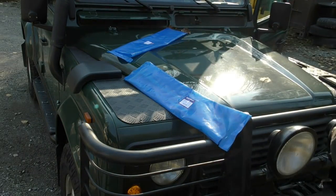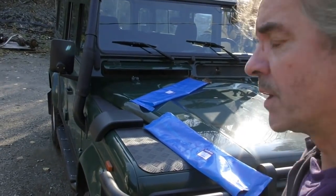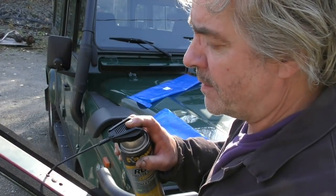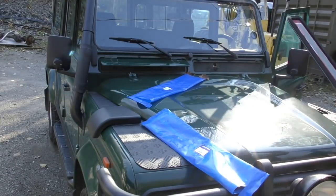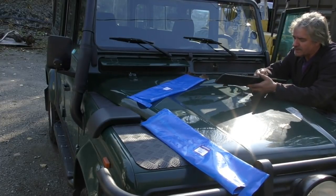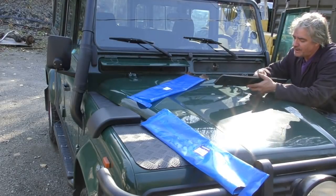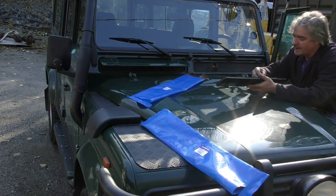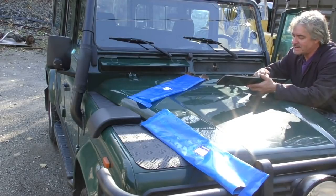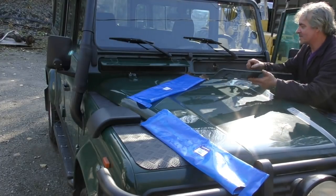First of all I'm just going to get a bit of Crown rust proofing to put on those screws. I'm going to put a bit of rust proofing in those holes to make it easier to get back on again, because these are a bugger. What I'm going to do is run the bolts down to make sure they're nicely lubed up before I fit them. Some of the very early ones had Whitworth threads in there — Lord knows why. This one here has been over-tightened at some point, so that's going to be fun.